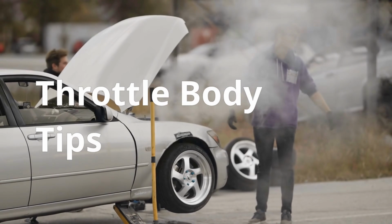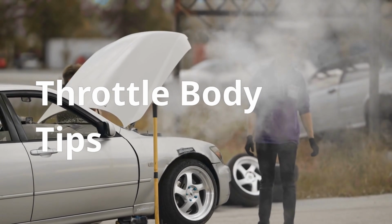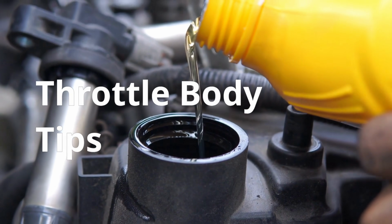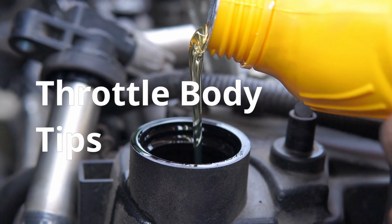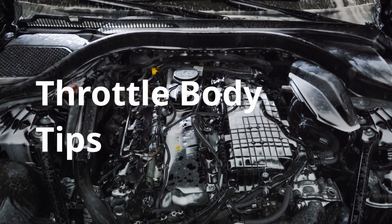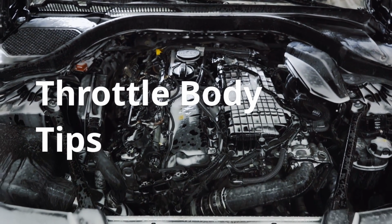Can I damage anything if I spray too much or do it wrong? If you overdo it and flood the intake, it can cause hard starting or engine misfires. On electronic throttle bodies, prying open the throttle plate by hand can damage the motor. Just spray in short bursts, use a rag to catch excess runoff, and never force anything.